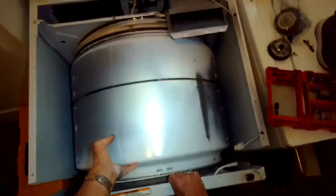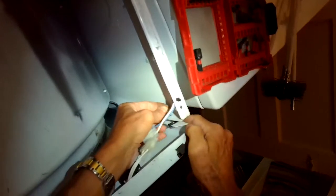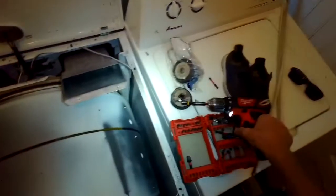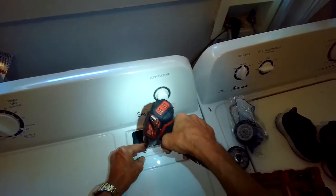The new support wheel is doing great. We've really limited the friction down to the normal amount designed by the engineers, and we've got the motor nice and clean with all that lint out — no more fire danger. I'm putting the front panel back on its bottom clips: lift up about half an inch, let it set down onto the left and right clips, then add the two screws that hold the top of the front panel. Push the metal clip back into position, then tighten up the screws.